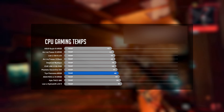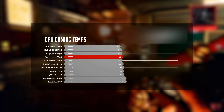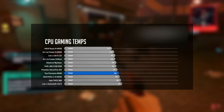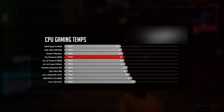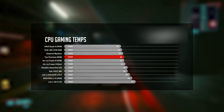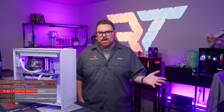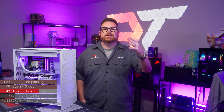And this is why we test on AMD and Intel. During our 1440p gaming test, the Panorama ARGB 360 held average temps at 48°C on Intel and 53°C on AMD. On Intel, that put the Panorama right next to the 360mm Phanteks Glacier 1D30, and on AMD, it was in contest for third place with Corsair's iCUE Link H150i. Basically, the Panorama found its home around the warmer-running AIOs on the Intel side, but for AMD it showed more of what it's capable of.